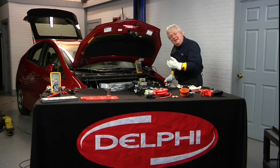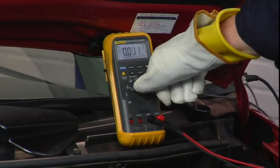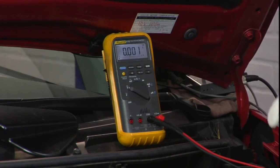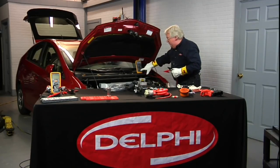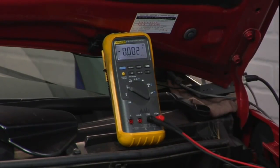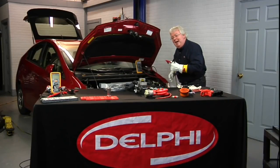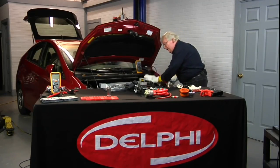Now I know that sounds kind of silly, but how many times have you accidentally had the meter in the wrong position — you had it on AC when you meant DC, or you had it on ohms when you meant volts, or maybe you forgot and had it set up as an ammeter yesterday with the leads in the wrong spot. We don't want to make a mistake like that and see zero volts when we actually have high voltage underneath this cover.